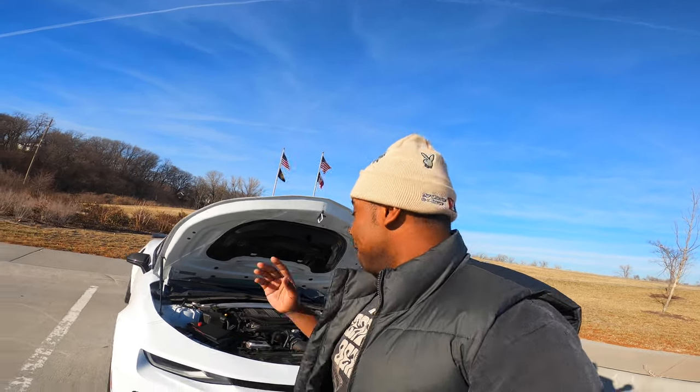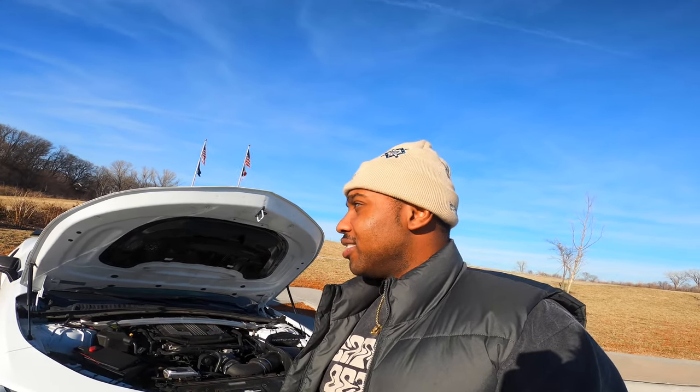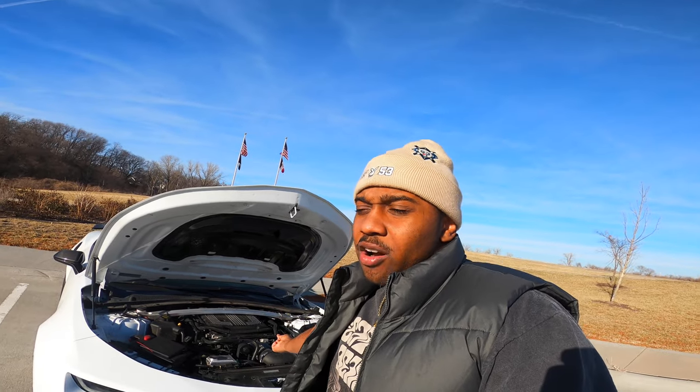It's gonna heat faster, and it's gonna be a way slower car than it is. It's not gonna be FMC, which is fully emission capable. You have to bleed it, because if you get air pockets in the supercharger, like I said, it pulls timing, it cuts power, and you turn a 650 horsepower car down to a 550 or 500 horsepower car.